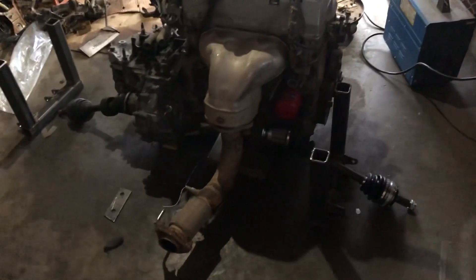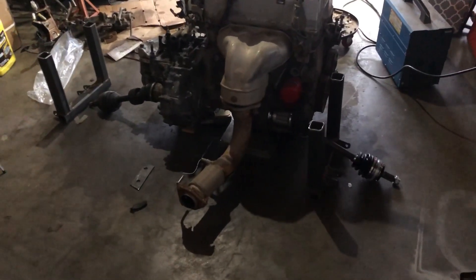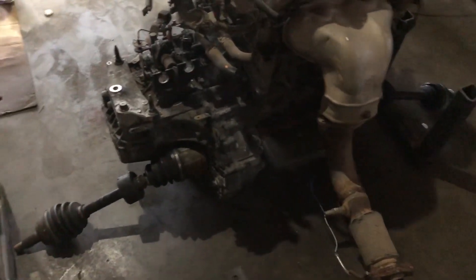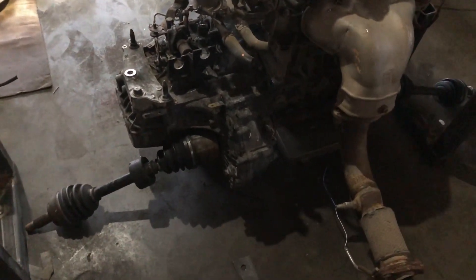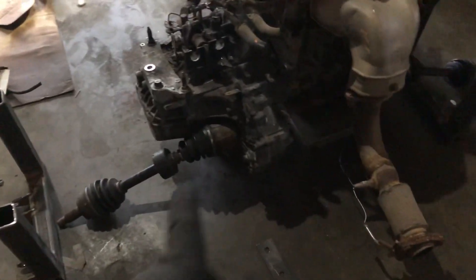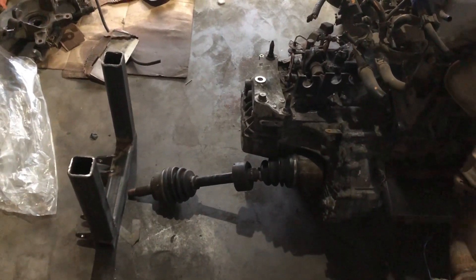Here's a little bit of progress on the tube chassis. I ended up just using OEM axles — it's gonna stick out a little bit over the fenders, so I'm gonna have to use some fender flares, maybe customize some. Using OEM axles, OEM half shafts. It's about 13-14 inches on this side and about 14-15 inches on the other side, so everything's gonna be centered.